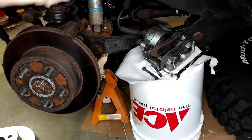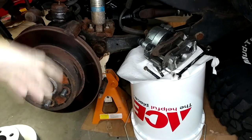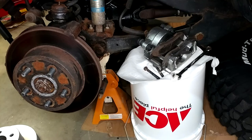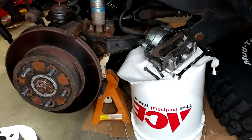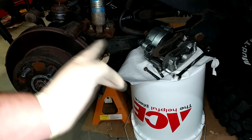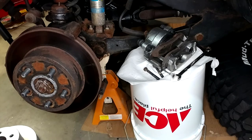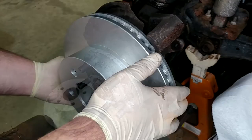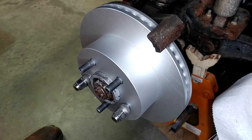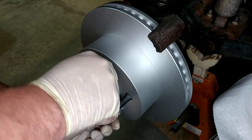So let's try this again. Same old caliper - I've got it sitting on a five-gallon bucket, which by the way is great for calipers in most cases. The disc is nice and loose because I just had it off five days ago. The only thing to do now is load the new pads in, properly grease up all the caliper interfaces that I didn't grease well last time, use the new bolts, and that should be about it. First thing we should do is double check our rotor. Old and busted off, new freshness slid on, take a couple of lug nuts - no rubs, spins right. This is the one we want.